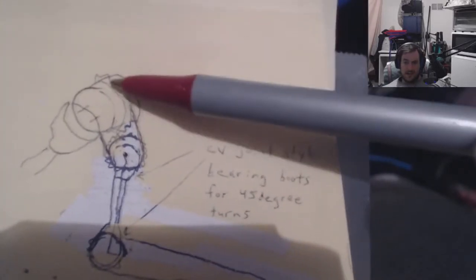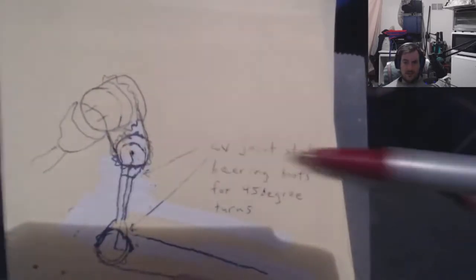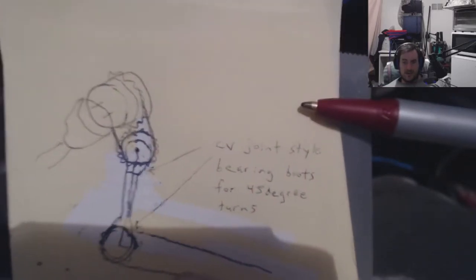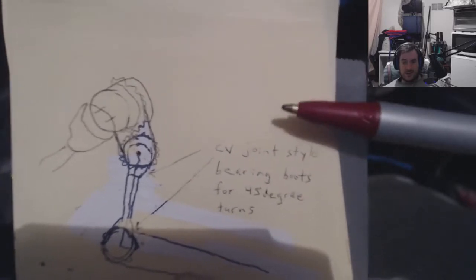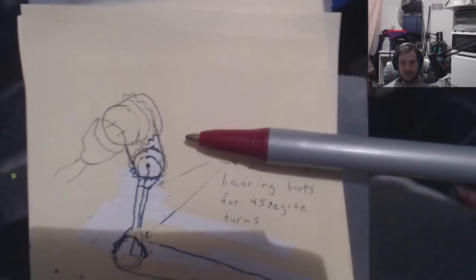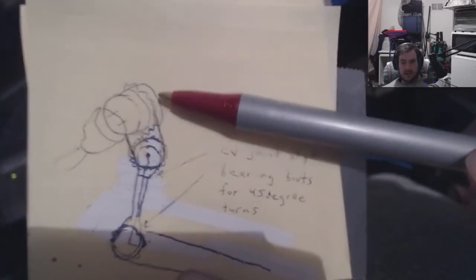Originally, my design was to have the chain come directly back to the rear of the car where it connects to the motor. But there is no direct channel. That actually goes through the passenger cab, through the firewall, and it'd be going just underneath your chair. Your legs would be straddling it. It might interfere with even the gas pedal and brakes. You can't be coming directly back. This is way too up high. This is almost knee level to a passenger.